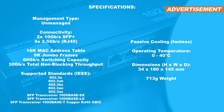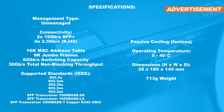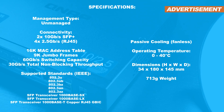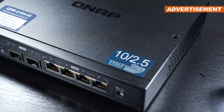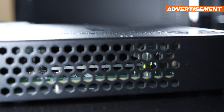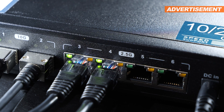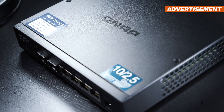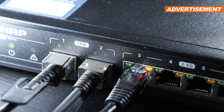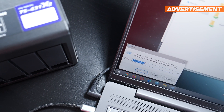Let's take a quick look at the specs. As said before, unmanaged, then two 10Gbps SFP Plus as well as four 2.5Gbps RJ45 ports, a max switching capacity of 60Gbps, 30Gbps of total non-blocking throughput, and very important to many of us, it's a fanless switch — being cooled passively, therefore operates extremely quietly. Furthermore, the device comes with automatic loop detection. The build quality of this QNAP switch is top notch, the entire case is out of metal. The LED indicators emit green and orange lights to indicate whether or not you're making use of the full link speeds, for instance whether you're in fact making use of 10Gbps on your 10Gbps port, and same with the 2.5Gbps ports.